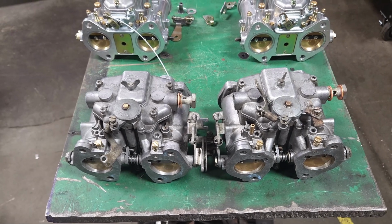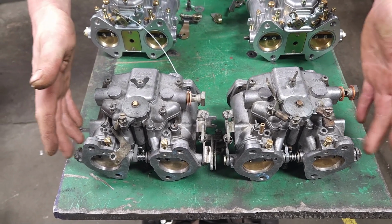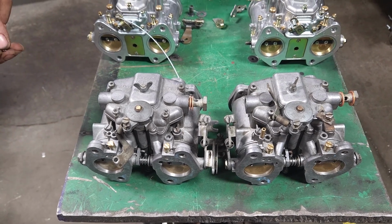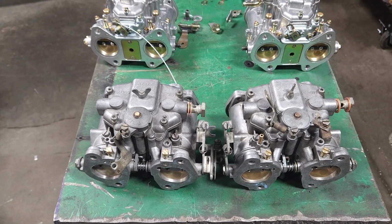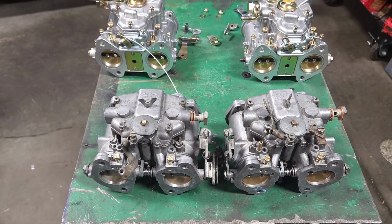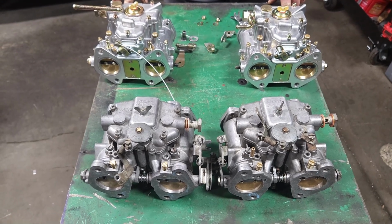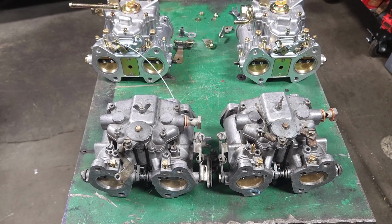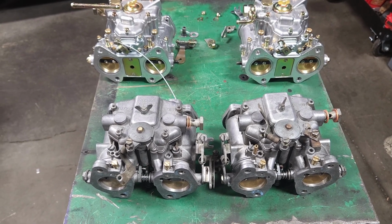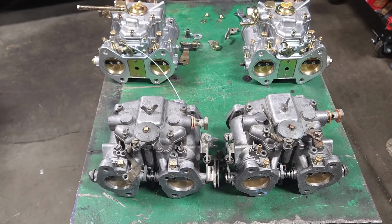So we ended up smoking out the carburetors, and these carburetors are actually leaking out of the end seals because the throttle valve shaft wallowed out the body of the carburetor, and it will no longer make a seal. That's something we really couldn't tell without rebuilding the carburetors, putting them on, putting all new seals in, and going, whoops, there's still another problem, right? Exactly. It's hard to know that's going to be a problem until you put new seals in it and test it. And that's what we did.